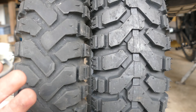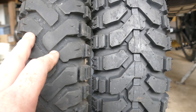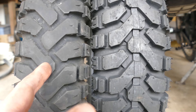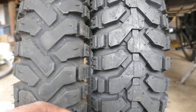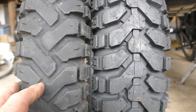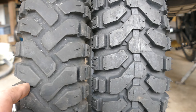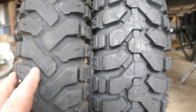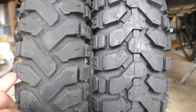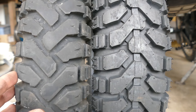He got back to me and said it sounded like with my luggage and running at around 34-35 psi especially on the highway, that was likely the issue. Their website says for 650cc's you should run at least 32 psi, but he said it's probably because I was running too low pressure. On their rental bikes they prefer much higher pressure - like 38-40 psi. So although I was running within their website's suggestion, they recommended more and said maybe that was part of the wear.